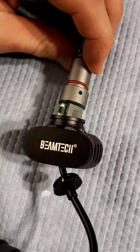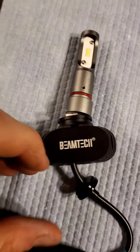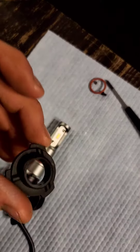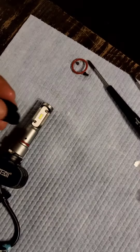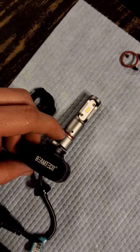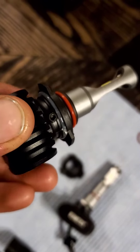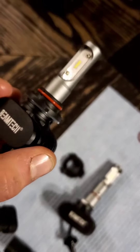So if you can get a little more silicone around and go up inside the light, reseal that back up. Then when you put this piece back on that locks it onto the light housing, put a little bead of silicone around the light and the base. When you're done, you'll have a nice little bead of silicone affixing that to the housing.